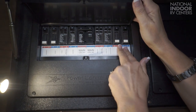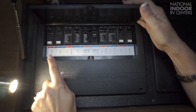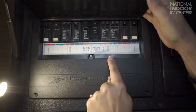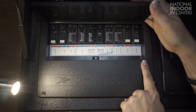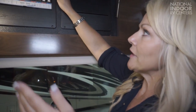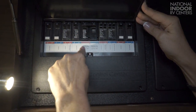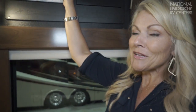Let's talk about 50-amp service. We use it all the time as RVers, but if you were to talk to an electrician, he would see that you have main leg one and main leg two. Main leg one has 50-amp service, main leg two has 50-amp service — so 50 plus 50 equals 100. We have 100-amp service coming into the coach. Remember when I told you that one of the things the inverter does is pass through current? When we are operating these items here, whether we are plugged into shore power or running our generator, we have 100-amp service coming into the coach, going down into the basement where our inverter is located, passing through and coming back to the inverter box. As it passes through, it charges our batteries.